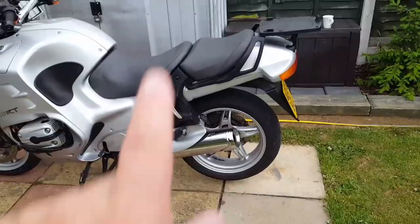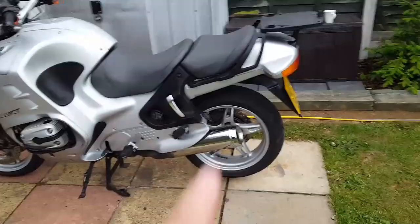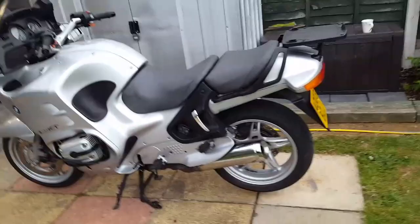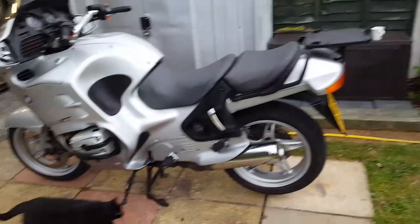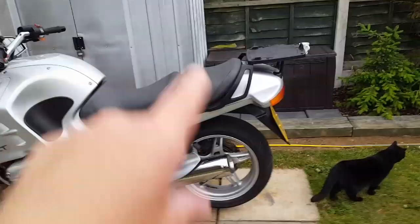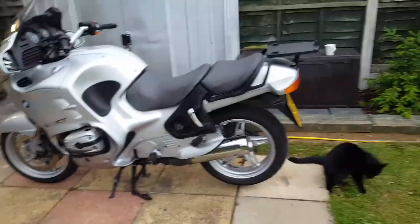I forgot that I'd stiffened up the suspension for luggage and pillion. It's a pure guess - just going by what the manual roughly gives you. So I've been riding around with quite stiff damping on the back end. It's not the preload, it's the damping. So I've stopped and softened that up. Then of course when I go out with Tracy next, I'll have to wind it up one or two notches like I used to do on the V-Strom and the XJR. It's there to be adjusted, so adjusting it seemed to be the right thing.